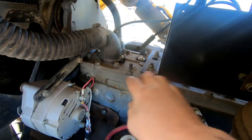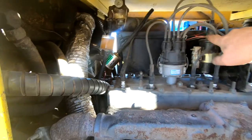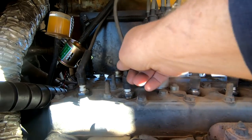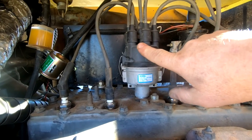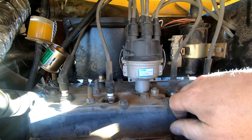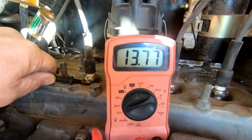I think I may use a stud right here, clean it up really good, and use it as a common negative post that I can send all ground wires to, and hopefully get better ground. I get a spark from the coil to the coil wire that goes into the top of the distributor, however I don't get a spark at the ends of the actual spark plug cables. There's either corrosion preventing the spark from getting to the spark plugs, or it could be a ground issue — and my suspicion is it's a ground issue since I've been playing around with the ground. I'll check to make sure we don't have corrosion in there. On the positive side of the coil we're getting almost 14 volts, which is great — it needs to be at least 10.5 — so my guess is the coil's good.